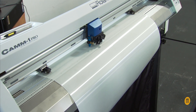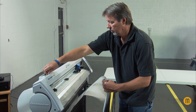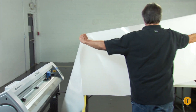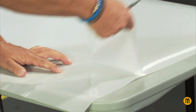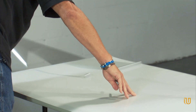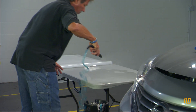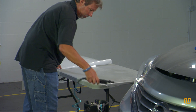While the plotter is cutting the film, do not allow the film to touch the ground. Place the cut piece of the film on a flat surface with the release liner down. Remove the excess film that is not part of the kit pattern from the release liner. Note that the plotter does not cut through the release liner. Then carefully remove the cap sheet, which is the top layer of the remaining kit pattern. Using the soap and water solution as a lubricant between the layers, gently separate the liner from the film.